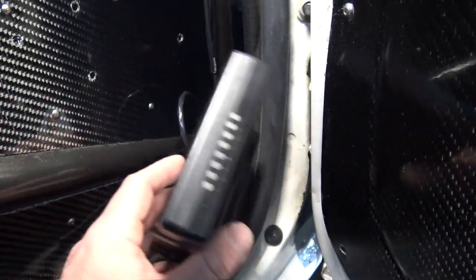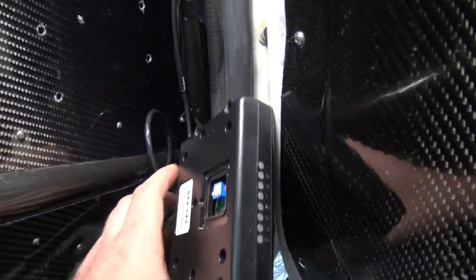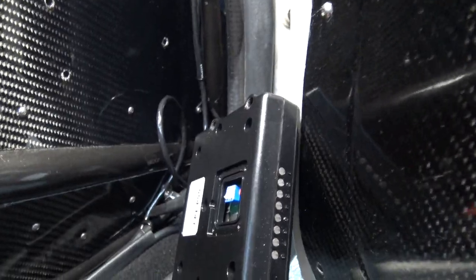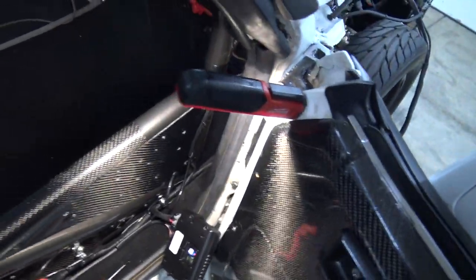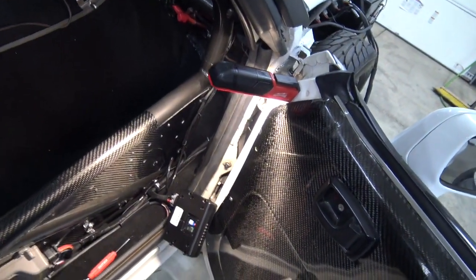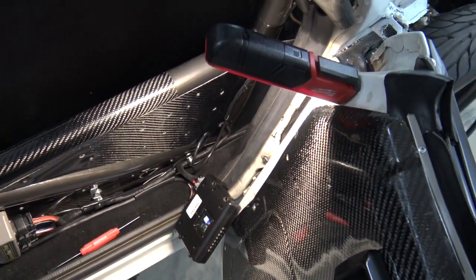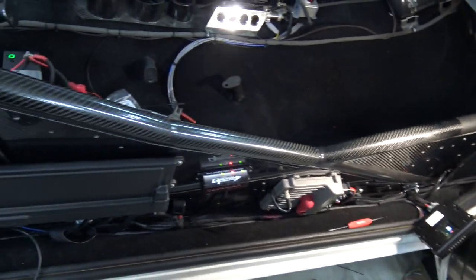All you got to do is pin out your injectors like I showed earlier, coming out of the connector from here and out to the engine. So I'm not going to cover that with this car because it's a little bit more involved. It's got to go through a bulkhead connector and whatnot. But again, this does not send power out to your injectors. It's only the switched ground, the pulsed ground to activate them.